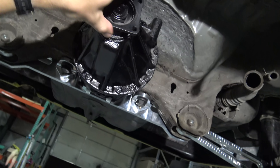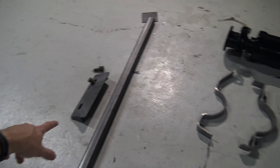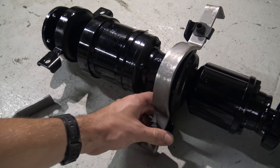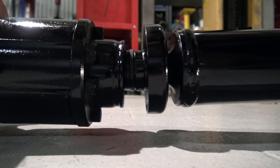That way I could actually get this top plate bolted on. One of the other things is I went ahead and dropped off the drive shaft. The drive shaft guys are a couple days out, so we're kind of waiting for that to get back. But Justin, when he sent this plate out, he sent these out as well. These are basically where the viscous coupler mounts. It goes right there. So obviously you need to mount this solid in the car. I'm kind of not sure whether the short end of the drive shaft goes towards the diff or if it actually goes towards the front. So this little spot right here basically has a little bit of play in and out.